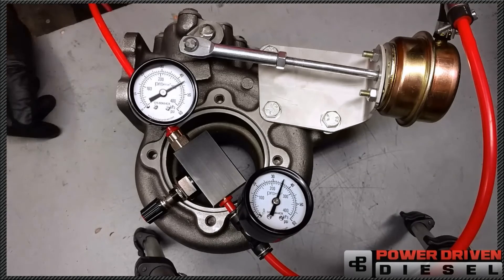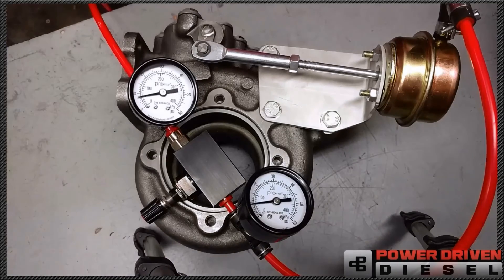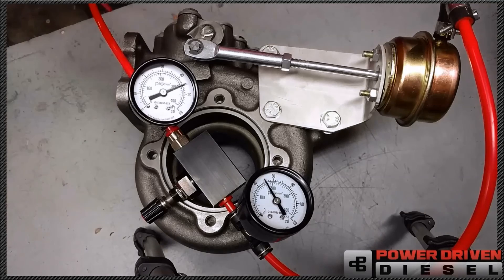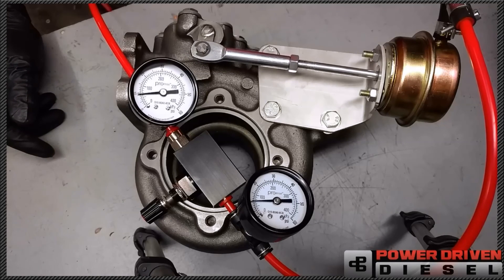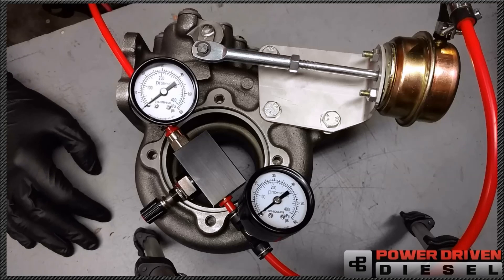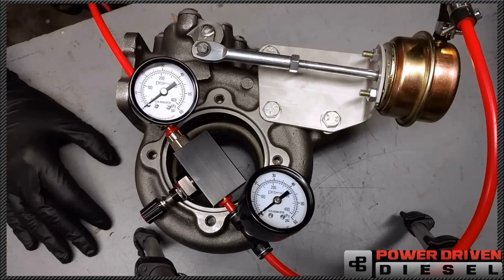And that's just how this works. You can adjust all this while you drive down the road. As the boost gets off, there's no bleed orifice — what you're hearing is a regulator if you hear anything. The boost can bleed back and the turbo pressure is still well behind your boost reading — you're controlling it all with this device. Now we're going to show you how this works on a dyno — we have it hooked up on a test truck, and we're going to show you how to tune this and what things will be helpful in tuning it on a real truck.